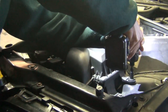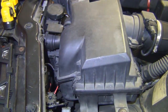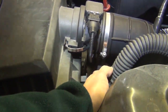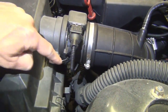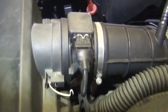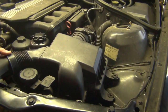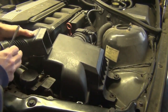I'm going to take the airbox out — that's going to be a 10mm. Take the screws off the side. You may have a connection right here on the airbox that connects the harness. The rubber piece on this vehicle has fallen down, and that pushes on right here, so separate that if it's still connected. We're just going to pop off the connections on the mass airflow sensor right here, using a screwdriver to separate the two clips.